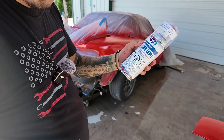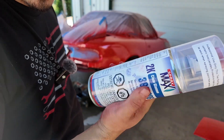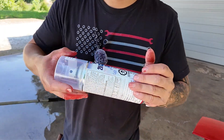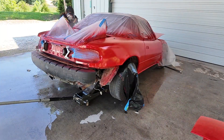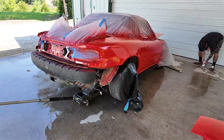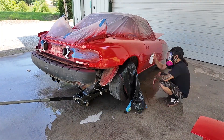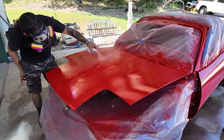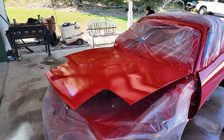Time to hit it with some 2k clear. I'm going to mix this — it takes about a minute to shake. I've got them under the sun so they should be hot and spray real good. This is one of my favorites; I've used it multiple times. It has a two-part mixture — when you pop it, it blends the hardener with the clear. If you spray it at a consistent speed across the panel, it lays really thick and smooth, so I don't think I'll have any problems when I start wet sanding before buffing.